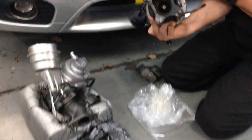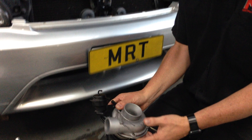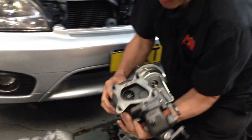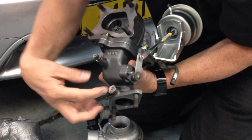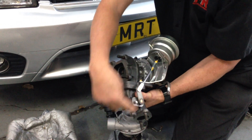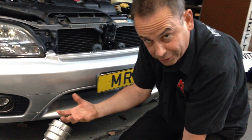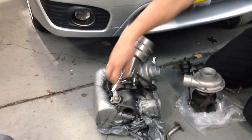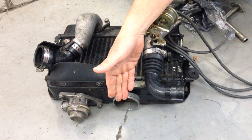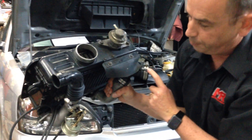What we've got here is the original factory turbo with the integral wastegate on the exhaust side. It's a tiny turbo because they're a twin turbo staged setup. The primary turbo comes on boost first, and then the secondary turbo, which sits on the other side of the engine, activates and kicks in around 4,500 RPM. This one doesn't have an integral wastegate, but it's got a valve in the exhaust manifold where energy comes up out of the exhaust manifold to drive the turbo when this diaphragm opens it. This diaphragm is controlled by the solenoid and the pneumatic control system, which is activated by the factory ECU. In combination with that opening, on the boost side — the pressure side — you have the two inlets to the intercooler, which then feed the inlet manifold. You've got the actuated secondary turbo feed on that one, and the primary turbo on that one.